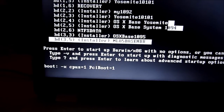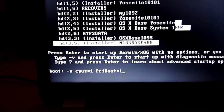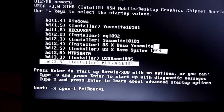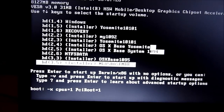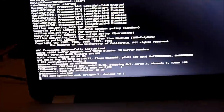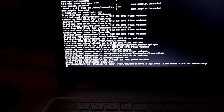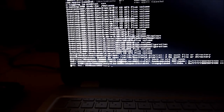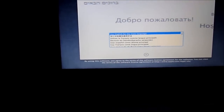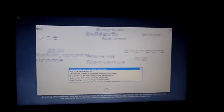All laptops with Ivy Bridge and up to Haswell, I'm going to use CPUs equal to one. For Mountain Lion for people who buy from Apple — you can create the installation disk from the original DVD. For Mountain Lion, you have to use an external mouse and maybe external USB keyboard also. So make sure you get those ready. The trackpad doesn't work — see? But if you put a mouse in there, it will run.